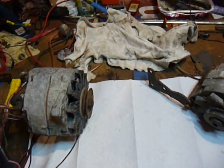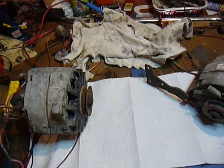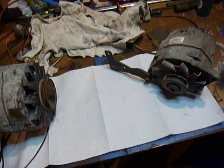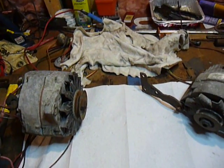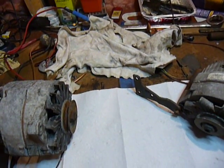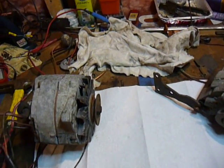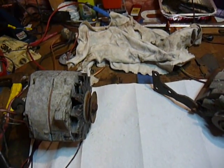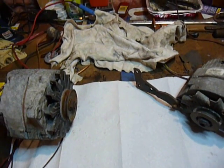The way it works is the only component that's purely 24 volt is the starter. Everything else — the alternators are 12 volt, the glow plugs are 12 volt, the rest of the entire truck is wired 12 volt. The way they do this is they have a resistor bank located directly behind your air filter, and what it does is knock that 24 volt voltage down to 12 volts to run things like your glow plugs and your fuel shutoff solenoid. These military trucks use either Wellman glow plugs or the 60G Delco — they're nothing special as far as glow plugs go.